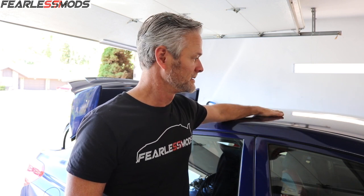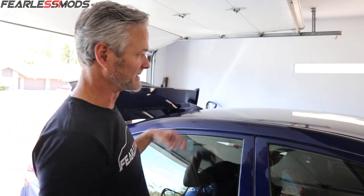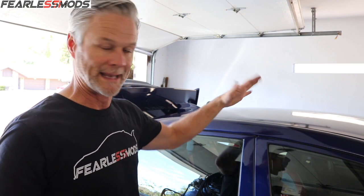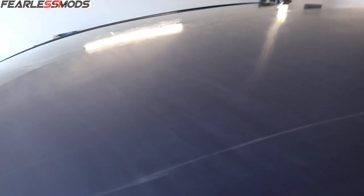Should have plenty of clear coat on it but I definitely don't want to sand through it. What I'm going to do is take a towel, soak it with water and just keep it sitting on the surface where I'm working so that it stays continually wet. Okay, the first go at the sanding here and it's looking pretty good. You can see there's some areas where we still have just a little bit of that misted, pitting type look. Most of it looks pretty good except up there towards the middle and right here at this edge where I haven't quite got it yet.